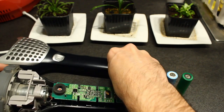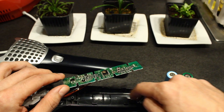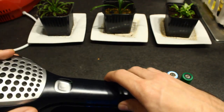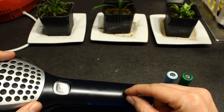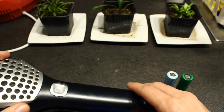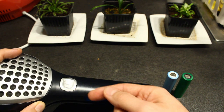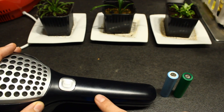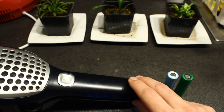If this proves to work, in the next video I will buy a lithium polymer and try to fit it inside. If it doesn't fit inside, I'll leave it outside. The lithium polymer output wires will be soldered to the board, and the balancing wires will come out externally. This way I can balance-charge the batteries from outside and also check the voltage to know how much usage time remains before the next charge.